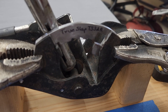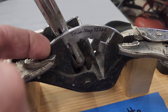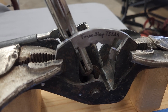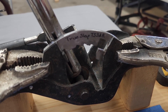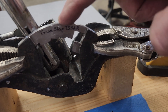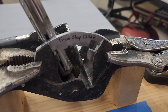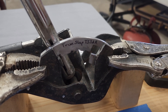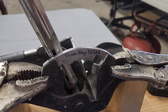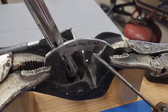These will need to be spot welded — I would spot weld it here and here, same thing in the front. When you mount these, all you do is get the front surface flush and get the top flush and clamp it in place. If you've got to adjust a little bit, loosen one clamp or the other and bump it around to get things flush. Don't worry so much about the back of it — you only need to get the front of it to get your park position located correctly. Once you get it clamped in place, test it a few times. This one's very easy to adjust — there was hardly any issue at all. Just get them flush and it works great. Once clamped, do your spot welds and that's all there is to it.